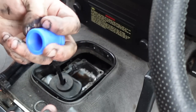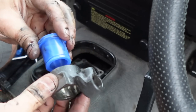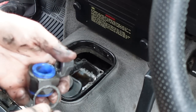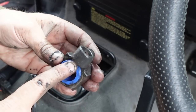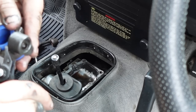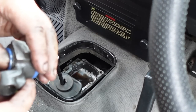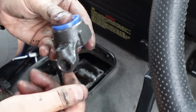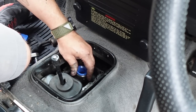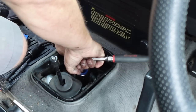I've got plenty of oil on my hands so I'm just going to use some of that oil on the new bush and then we can slide it back in. Then we've got to put our circlip back on — I've got to try and get the narrow piece near this edge here so that will go on easier. There we are, happy days. We have our new bush in place so we can now slide this back onto the shaft and relocate our grub screw.